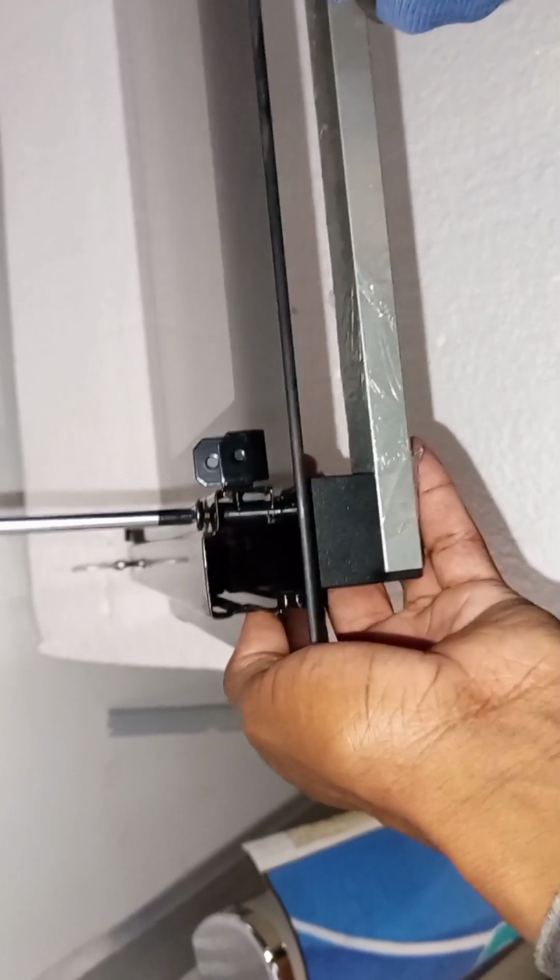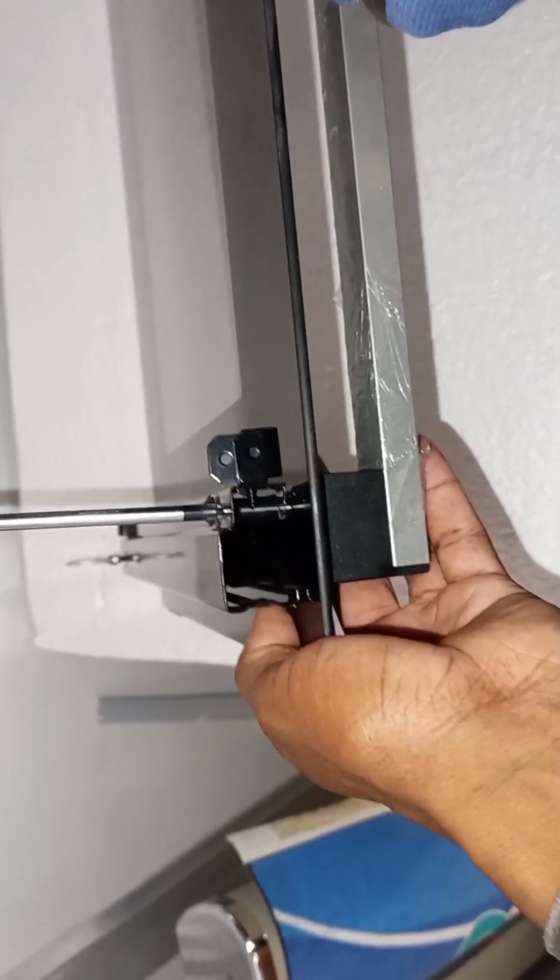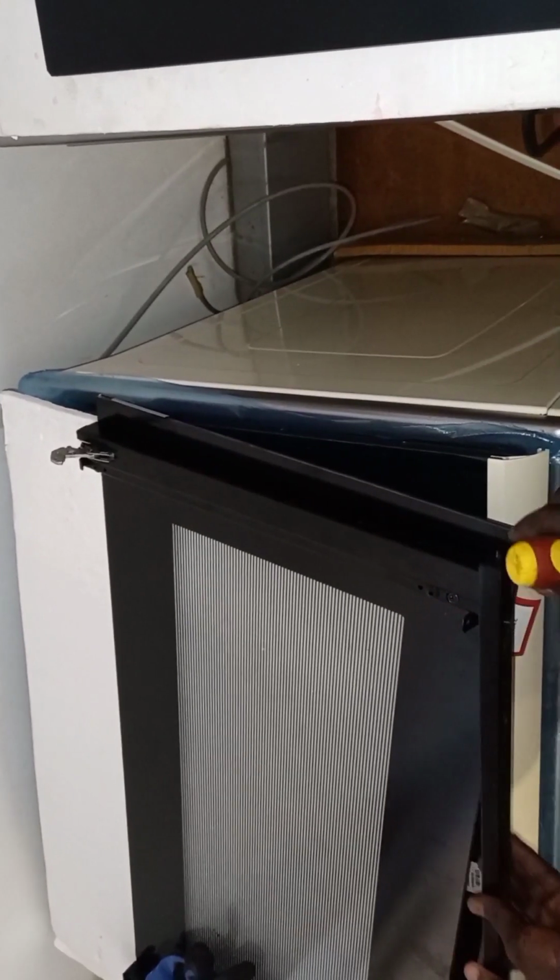So what we do on the left we'll also do on the right, and after that we will fit the inside glass. You should remember that the outside glass is mounted by the screws that mount the handle, so they keep it secured, and the clips that came glued to the glass, and also the black brackets that we fitted and aligned to the glass holes.